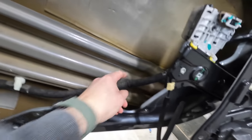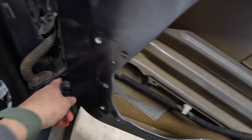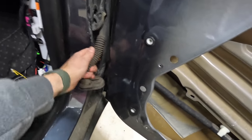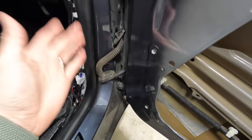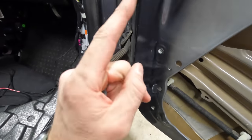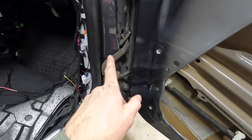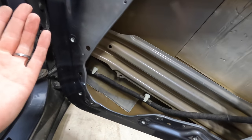One tip for the second door: unhook all the clips on the wire loom so you can straighten the grommet assembly out significantly. This helps a lot with fishing the wires through. You can do one wire at a time — I did two at a time and it was a bit difficult, but manageable. Just make sure you clip everything back or the door will rattle.